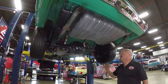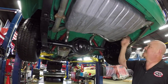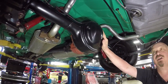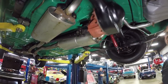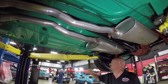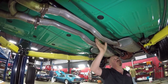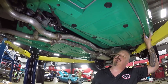We're underneath our Eliminator now. As you can see, she's actually nicer than she would have come out of the factory — they painted it grabber green on the bottom side too. You can see it's got a brand new tank in it. The exhaust looks brand new. The rear end housing is date code correct and lines up perfect. She's got right around a 3.25 gear from the factory. She is posi. We've got a sway bar back here. The guys will pull the brakes apart to make sure they're in good working order. It's got stock appearing mufflers. Everything is beautiful — back side of the rockers look good, the pinch welds look great. Everything about the bottom side of this car looks brand spanking new. The drive shaft looks brand new with nice paint on it. We've got what looks like a brand new brake line running up here — the fuel line looks like it's made out of new steel.